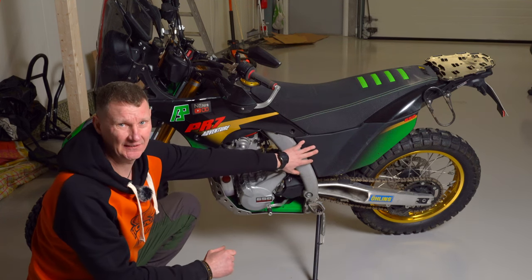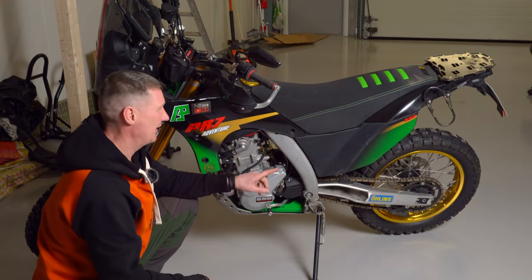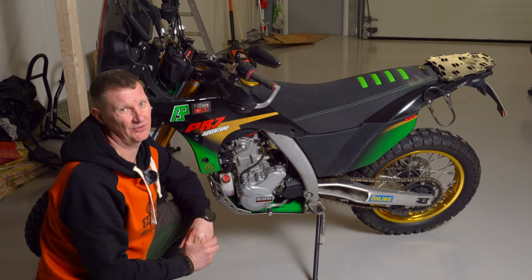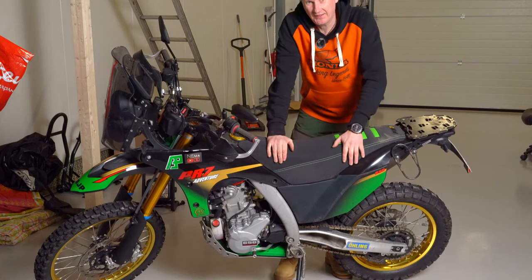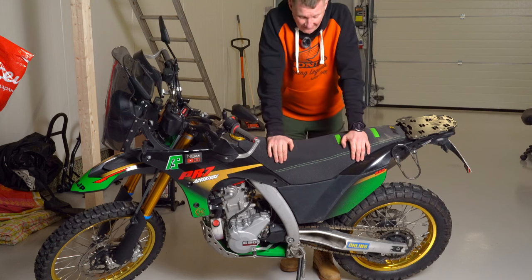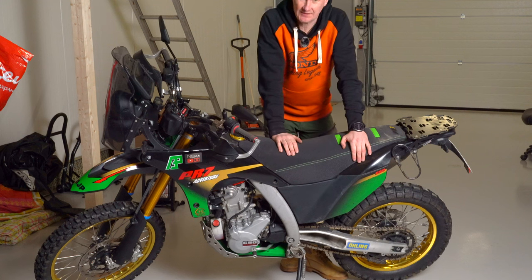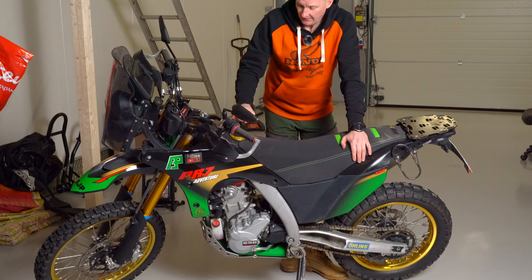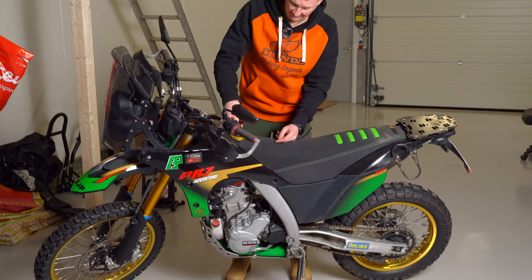This model has about 17 liters in the tank. If you go on harder roads or ride at 130 km/h on highways it will use 6 liters or more — quite a lot for a single cylinder. The tank is on the sides like mini saddlebags, which keeps the balance good because the weight is lower. You can easily do 300 kilometers unless you're pushing very hard.